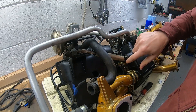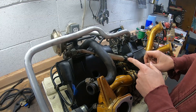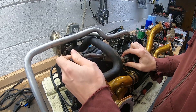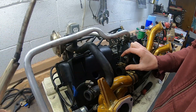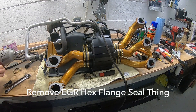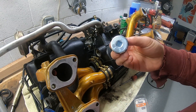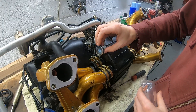There's an o-ring inside here that allows this pipe to move around, but I don't trust that seal. I read that you can unthread the hex right here and put in a drain plug. So I'm going to break the silicone seal I applied and remove this pipe — it'll seal better and I'll lose some weight. If you're looking for a plug, find something M22 at 1.5 thread pitch. This one is for a 94 Dodge Ram. The threads are a little deep, but I'll put some Teflon on it and jam it in — shouldn't have any leaks.